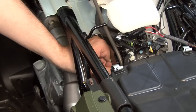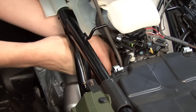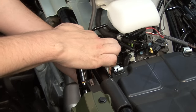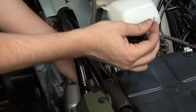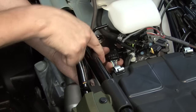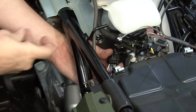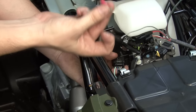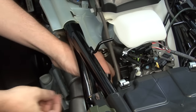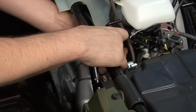Here on the left-hand side of the throttle body, I can find the throttle position sensor. I'm going to unplug the stock electrical connector from the TPS. I need to attach my single unterminated gray wire on the Power Commander harness to the stock blue wire with black tracer of the TPS. I'm going to use the supplied posi-tap to make that connection. The gray nut of the posi-tap is going to go onto the blue wire with the black tracer.